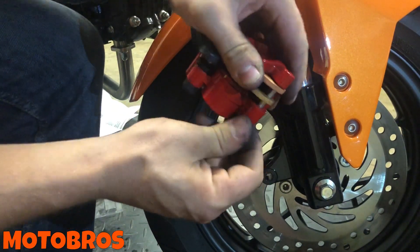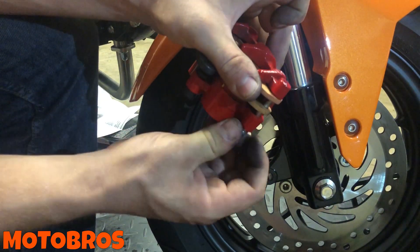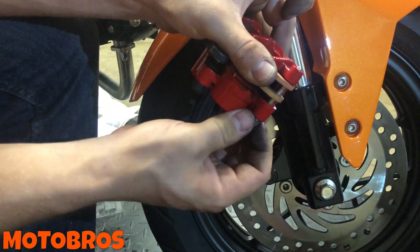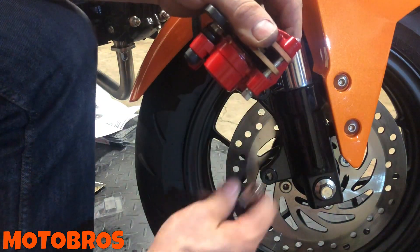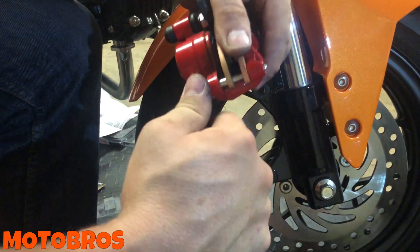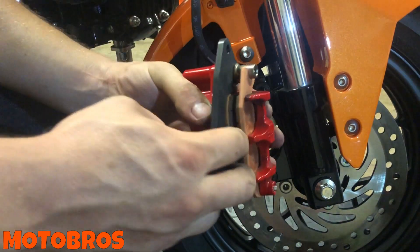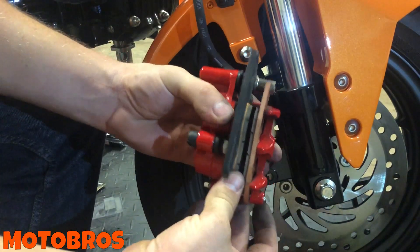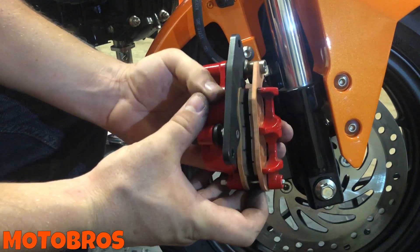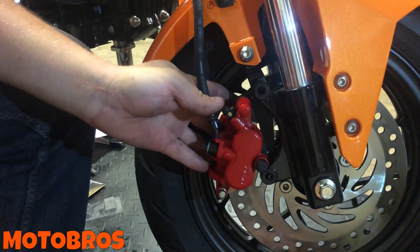You might have to put a little pressure on the pads with your thumb, pushing them into place. You don't need to tighten the pin immediately, but I recommend you do it right away so you don't forget — the last thing you want is the pin backing out and losing your pads. Push the pads further apart with your fingers and the caliper should just slide right on — very simple.